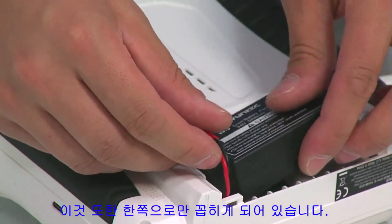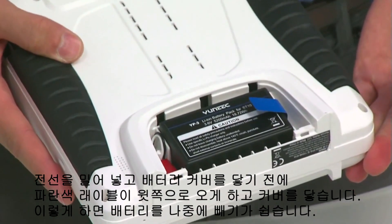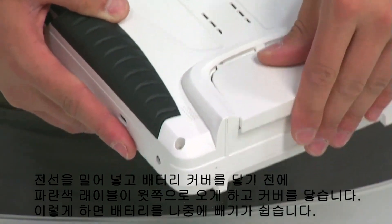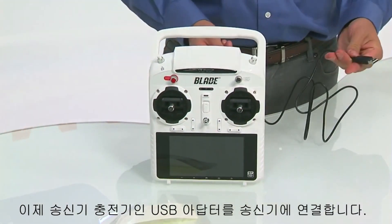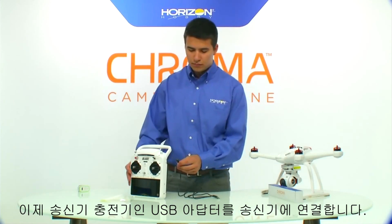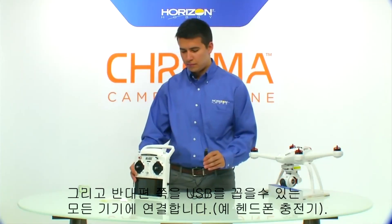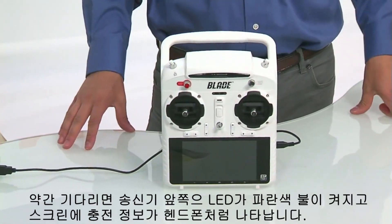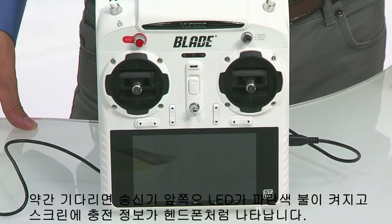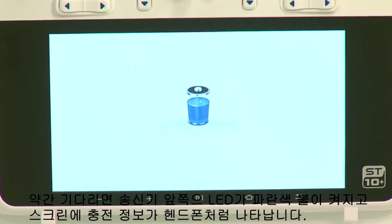There's really only one way to plug this in, so you shouldn't have a problem. Now tuck the wires away and put the battery into the ST10. Make sure the blue label is up so that if you have to remove the battery, it's easy to get to next time. Now install the battery door to seal the radio back up. To get the radio on the charger, use the included micro USB adapter and plug it into the side of the radio. Then take the other side of the USB cable and plug it into an approved USB power source. It'll take a few moments for the radio to register the power, indicated by a blue LED light on the front and the screen turning on. You may disconnect the USB cable when the on-screen battery icon shows full capacity.